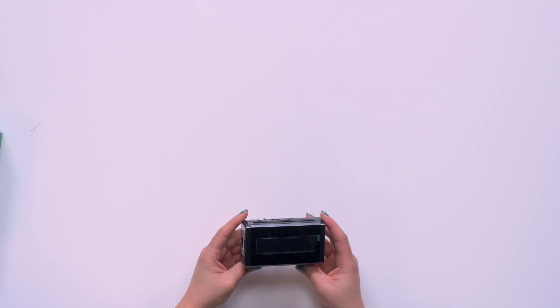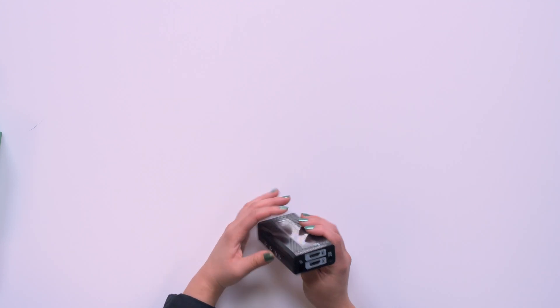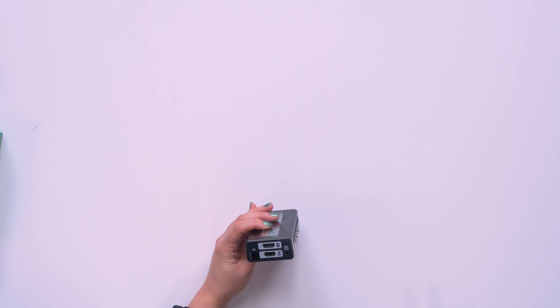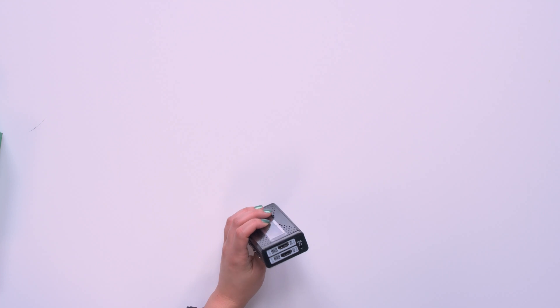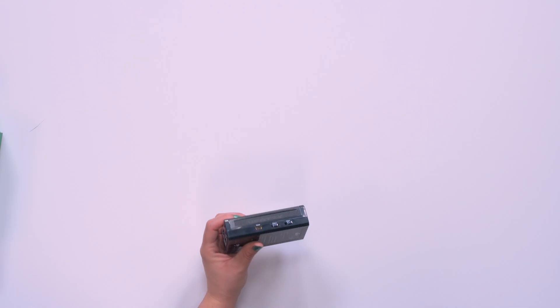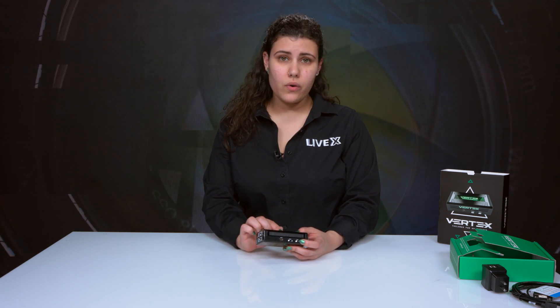As mentioned, this is a multi-function unit, so let's go over what it can do. For starters it works as a switcher, switching between two inputs and scaling them to one or more outputs. It also features ultra scaling — so it can upscale, downscale, pass through, and bypass. It supports any HDMI, any HDCP, and any HDR up to HDR 10+. A lot of the information I found during research was coming from gamers — it's really great if you want to stream your game live, as it provides virtually no latency and you won't lose your resolution while playing and streaming simultaneously.